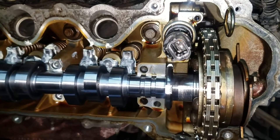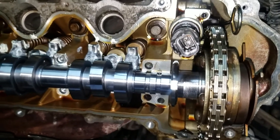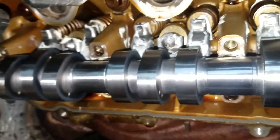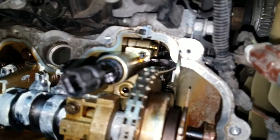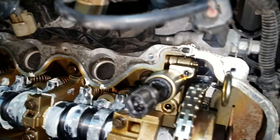So we got our cam installed, and here's something very important that will make your job go much easier: you're just going to want to slide the front of the cam into the phaser before bolting the cam in place, because if it's a little off and you get the thing bolted down, there's going to be a really hard time getting it to line up with the cam — there's a keyway there. So you don't want to be turning the motor over with the wedge tool holding the chain because it could pop out. I went ahead and installed the front of the cam in the phaser prior to actually bolting the camshaft down. Now I've got this all torqued — the torque on these cam bolts was 86 inch pounds — so you'll also need a torque wrench to do this job. Now that we got this bolted down and our front bolt torqued, I'm going to go ahead and pull this wedge tool out.